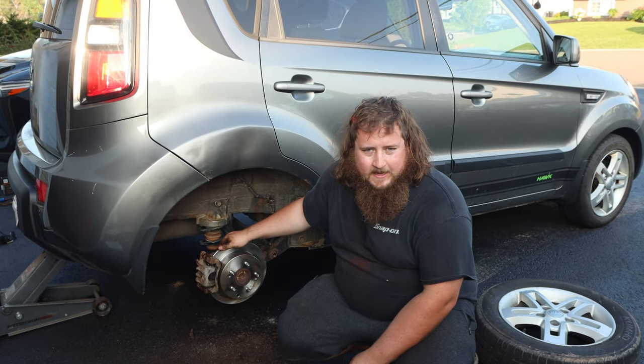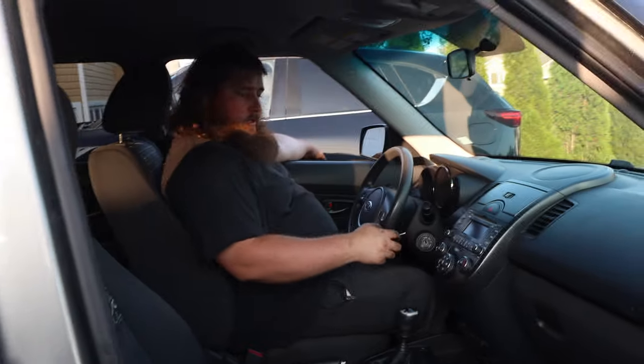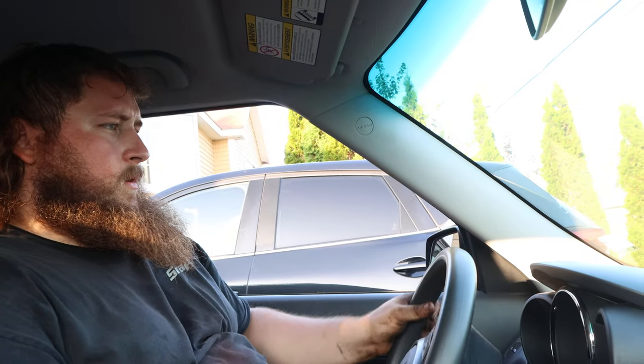There's another thing that comes with the kit — these little V-shaped clips that go in the pad bottom, and there are also holes at the top. They always create the pads to come away from the rotor when the brakes aren't applied. Put the caliper on — don't go too hard on the slide pin bolts because they're very easy to break. Give it a good spin and we know it's not making any contact. I'm gonna go ahead and put the wheel on and torque it all, then take it for a ride.